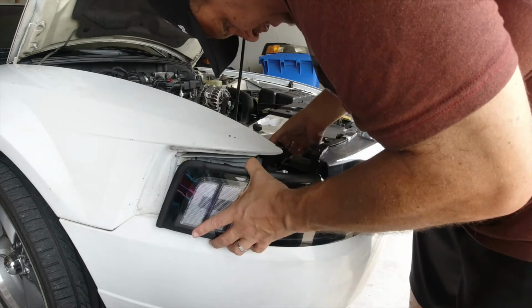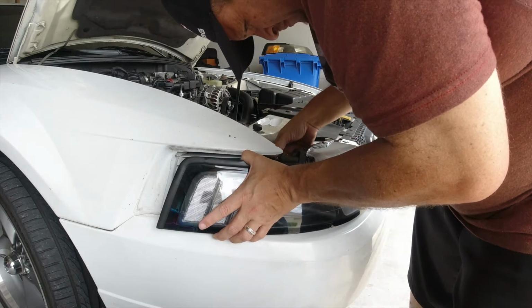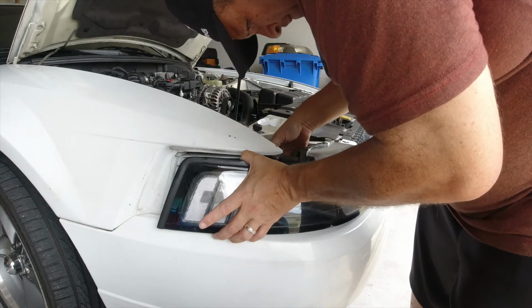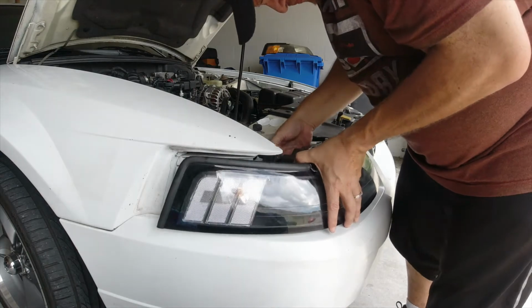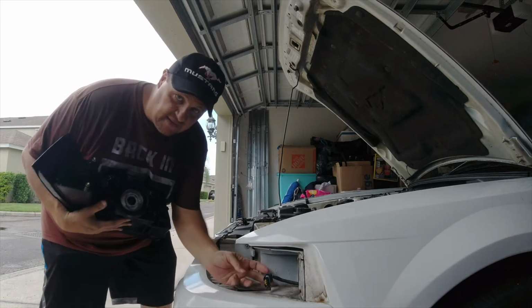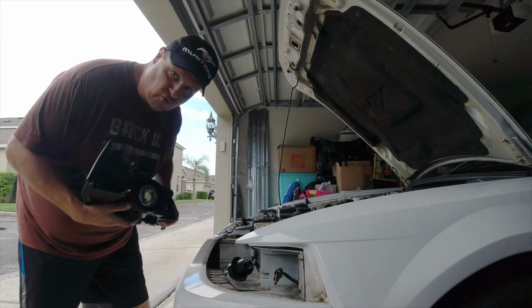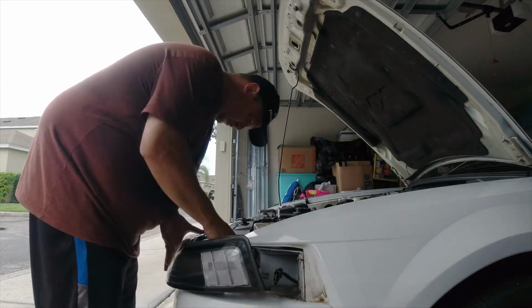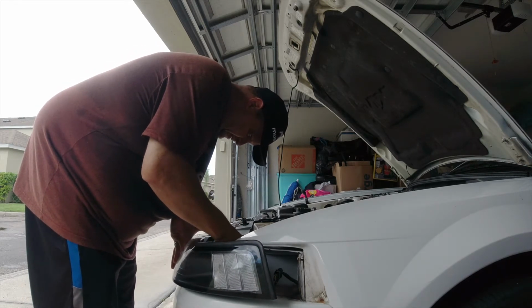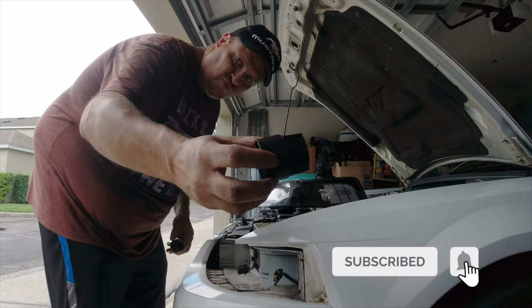Now I'm gently reconnecting the headlight. Just turned it in. Looking for it to kind of go into the sleeve here. Trying to find the sweet spot. Okay. So once again, we got the little side marker light right here, headlamp right here. I'm going to do a quick test just to see if this old one goes in and locks in easily. There we go. Out comes the bulb. See? So that I can remove the old sleeve.